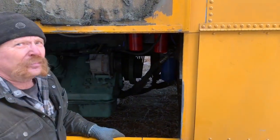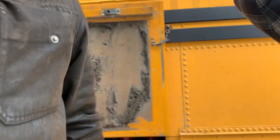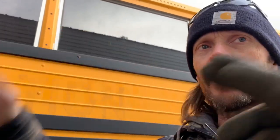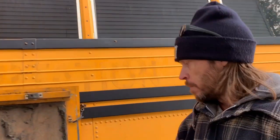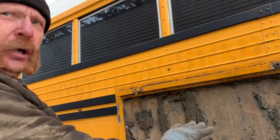Were we low on diesel? No. It's just when you have the system apart for the fuel injectors, this part of the system just drained out when it was open. It's like holding your thumb over a straw. You take your thumb off, everything runs out. Oh, I see. Once the system's closed up again, then the fuel stays here. Oh, okay, good.